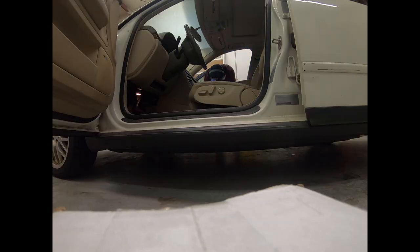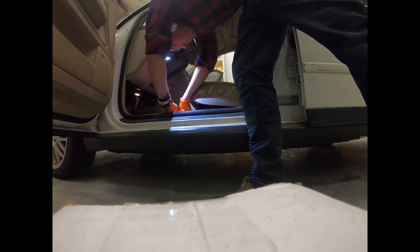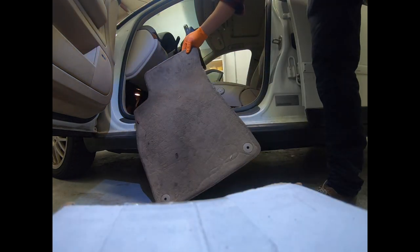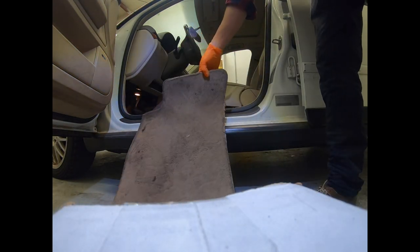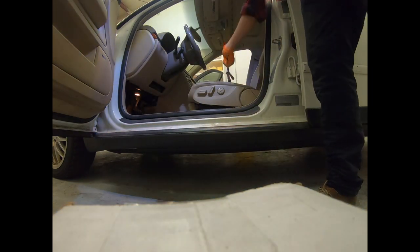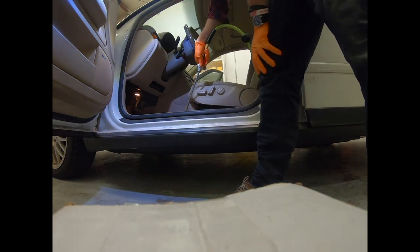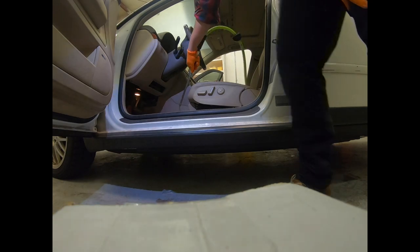First step here is just to get these floor mats out of the vehicle. You want to wear some nitrile gloves for a vehicle like this — in hindsight, probably wearing a respirator would have been a good idea. You can see how dirty this is, how black parts of that floor mat were. It's just going to be a task. The task here is dry soil removal first. It is so much easier to get the dry soil out first rather than to create mud and then try to extract it or blow it out.